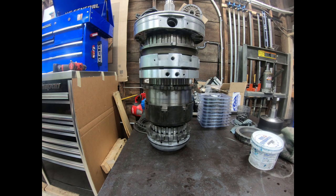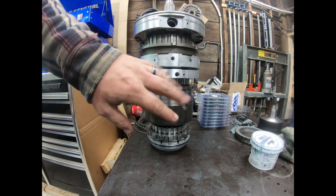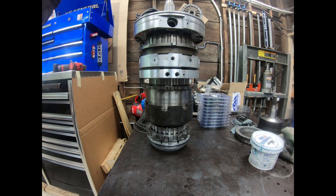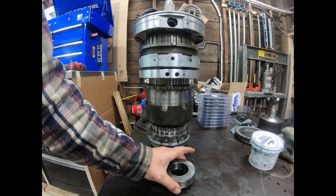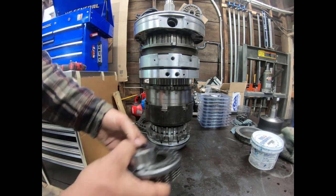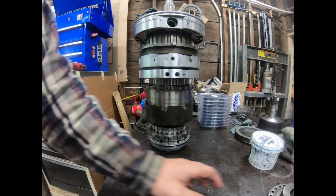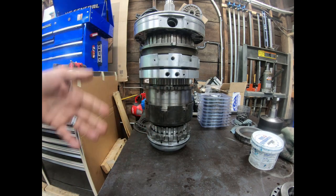This is the inside of a 4R100 as if you were looking up through the pan — your filter pops in here, and here are the feed bolts for your center support and your overdrive and intermediate piston assemblies. The only places this is bolted to the transmission case is around the pump at the front, and at the rear through the low reverse inner race. So it holds the low reverse return spring — all the pistons sit inside it and get bolted in there — but nothing is actually bolted to the inner race, just like nothing's really bolted to the front pump. So it's not very fixed at all.